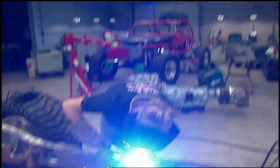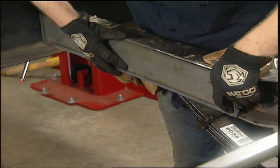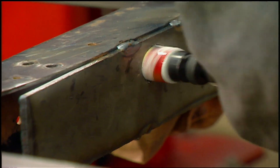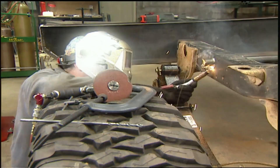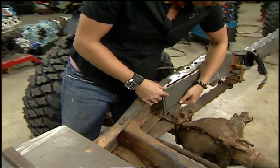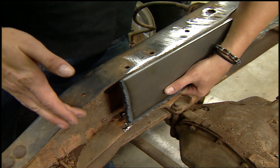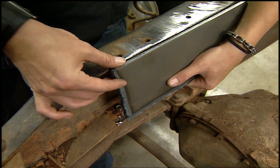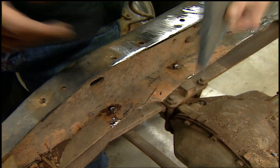Holy cannoli, that was hard. Boxing plates are welded to the frame. A 1-and-5/8-inch hole is drilled through both the boxing plate and the original frame, and a new cross member is welded in place. Another trick to remember when boxing in your frame: when you cut your boxing pieces, you want to cut them a fraction of an inch shorter than the frame itself. That way the weld will fall in the corner and weld on both pieces of metal. Whereas if you had it flush, you're only going to have your weld on one piece of metal — and it'll be weak and break easily.